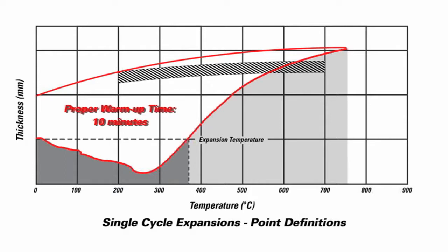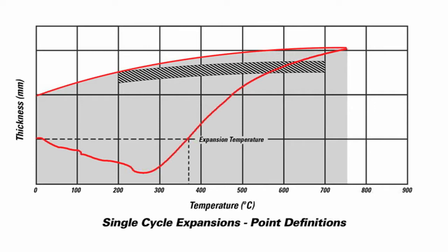What's important to know is that during that time, if the vehicle is actually driven or exposed to highway speeds, the matting is not holding the block as tightly as it should, and you really risk a portion of the drive time where that block could come loose. Once you've gotten that first cycle and the car's gotten up to operating temperature, the matting's expanded, and you can see in the upper part of the chart what happens to the matting after that first drive cycle.